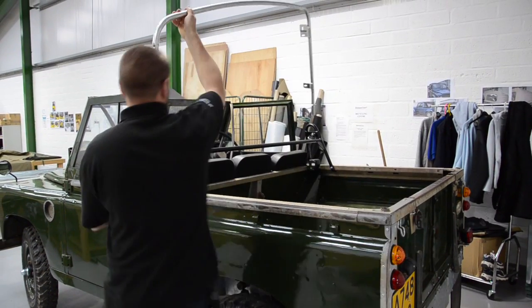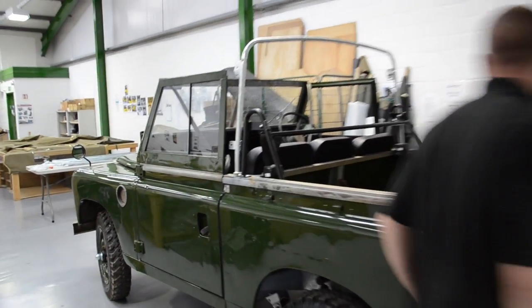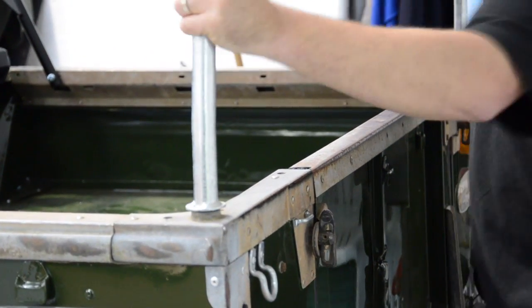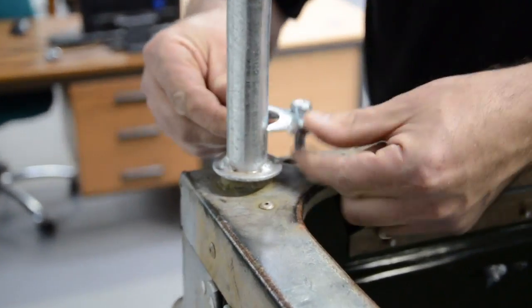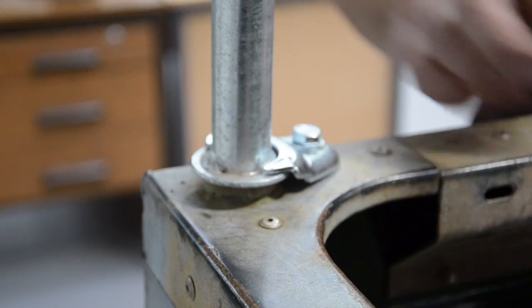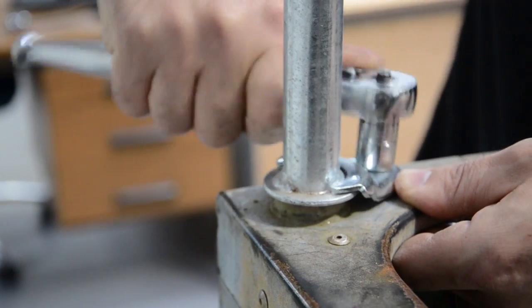First hoop. The socket's already in the car. The rear hoop is exactly the same — it literally just slides into the sockets. They both slide down into the stoppers. There's a washer on the top of the clamp, goes through the pre-drilled holes, with washer and nut underneath. Do them up until they clamp down tight.